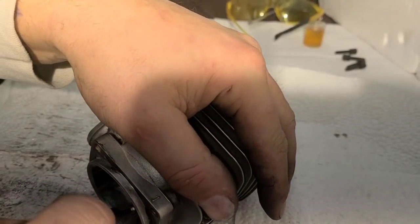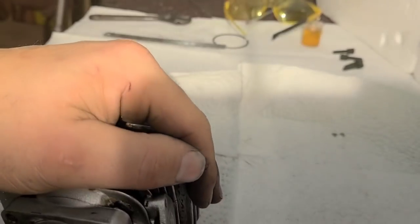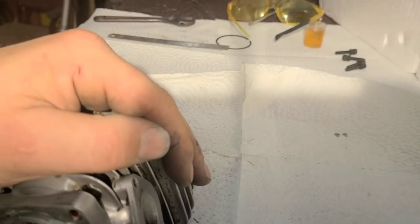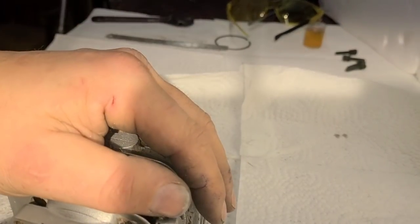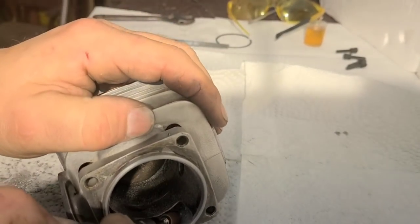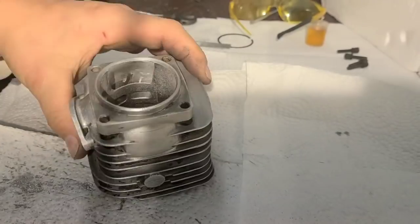Remember, these corners where you've ground are going to be sharp. I'm just going to go over them right now, and then I'll show you guys how to smooth everything at the end of the series. Pay particular attention to the edges or you will cut that ring into shreds when you're on the saw — that's the most important thing. Okay, there's our transfers.